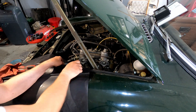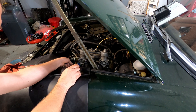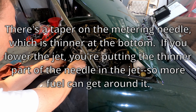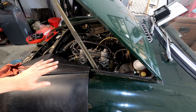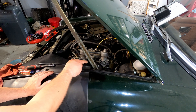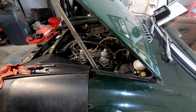So we're going to lean out this one. To make it more rich, you want the jet lower. To make it more lean, you want the jet up. The jet is controlled by these on the bottom — we're going to screw it in because we want it a little more lean. Now we've got no difference in sound between those. The mixture was actually pretty close on these. If you can't remember which way to turn those jets, if you turn it far enough in the wrong direction, you'll know — just start going back the other way. You want them both even, and then double-check your balance.